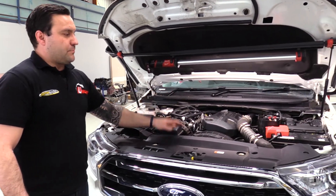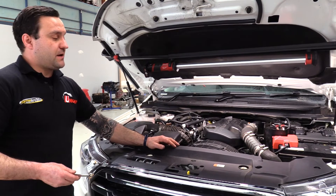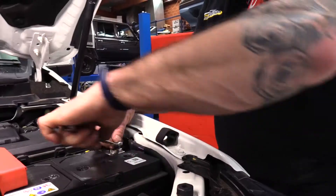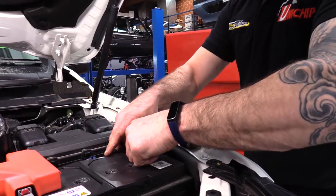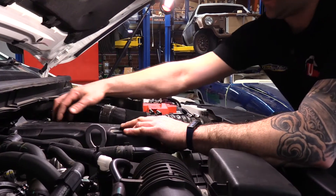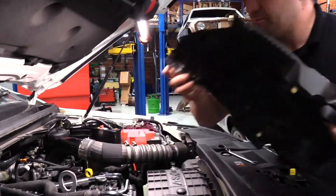Now let's move on to the car. I've already completed the complex task of opening the bonnet, so as you can see this one's up already. Once the bonnet's open, grab that 10mm spanner we spoke about and undo that negative battery terminal. Now that the battery terminal has been successfully removed, there's a foam engine cover on top of the engine which we're going to have to take off so we can get to our sensors. Simply lift it up — there are some hoses at the back which you need to push out of the way, but with a little bit of persistence the engine cover will pop off.